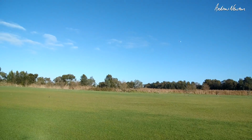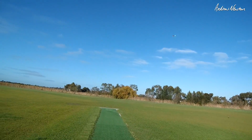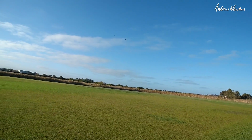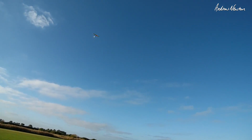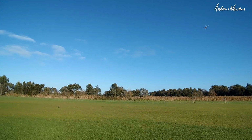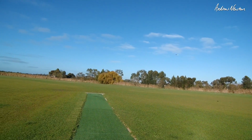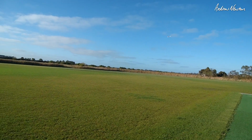4.5, 4 amps on half throttle there. So let's try minimum speed cruising. 2.9 amps. 2.5 amps. Can fly on 2.5 amps. 2.3 amps. So long flight times, nice, lazy, calm weather flying. 2.3 amps. And I better take heavier batteries, 2.8 amps.